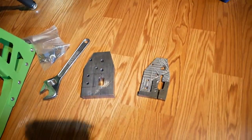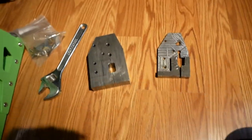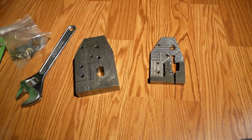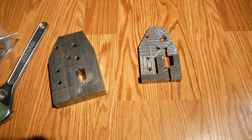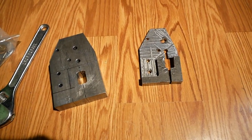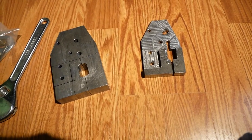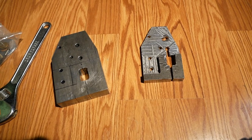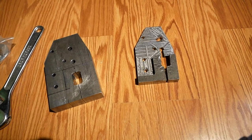Let's talk about my favorite subject: swing arms! This is swing arm version 3. Version 1 was the factory ones — a little teardrop-shaped thing with a single bolt hole. They were woefully inadequate and promptly turned into a nice V shape and failed. So I made another set out of 4140 steel that basically just captured the last eighth inch of shaft flat, going beyond the dropouts. And of course that wasn't enough either.